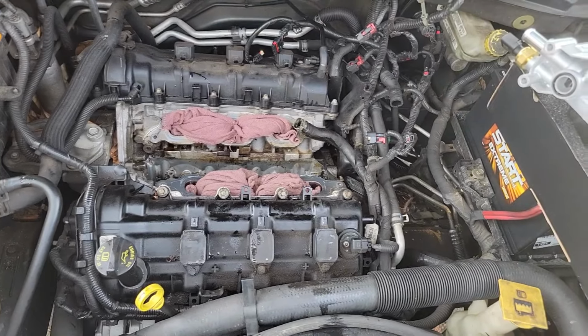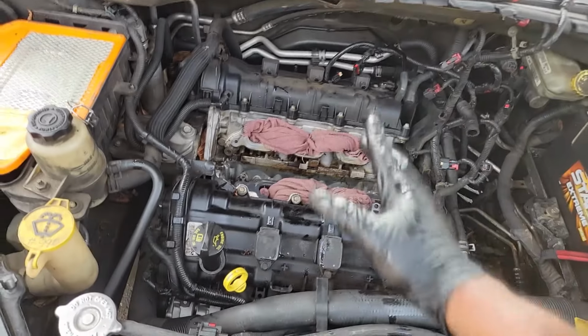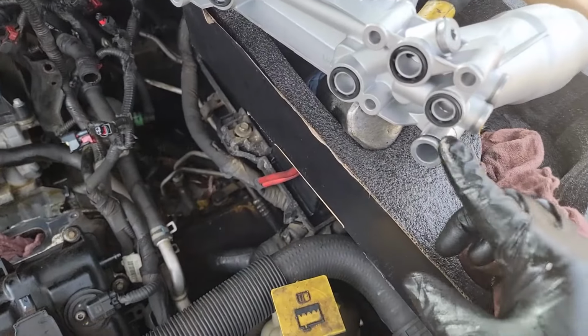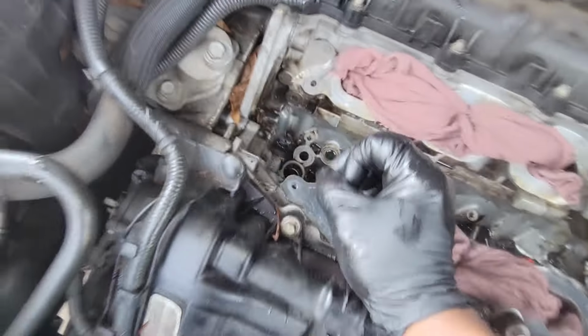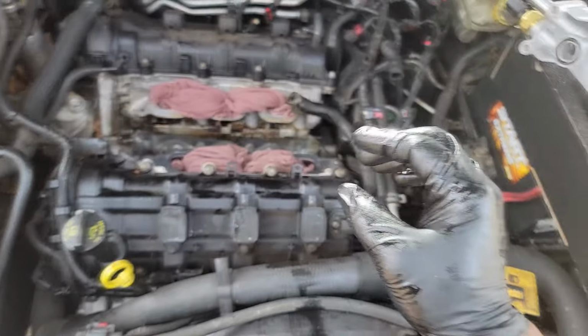All right, guys. Where we at? He's going to get the oil, so I plan on being done by the time he gets back. I'm not going to start this until he changes the oil. All right. Let me get this thing on, lube it up there. Remember what I told y'all, no RTV. Stick a little lube. I mean, it could be engine oil, as long as you lube this up right here, because this is the part that slides down into here, all right? And you want a clean, nice slide down. You don't want to go in there dry. Trust me, that don't feel good.